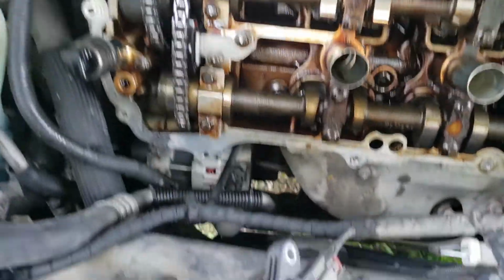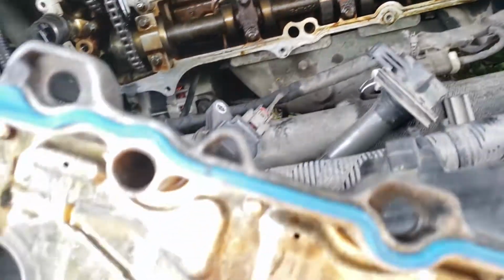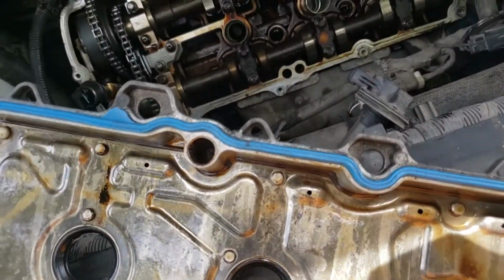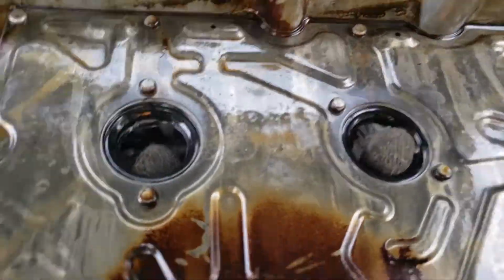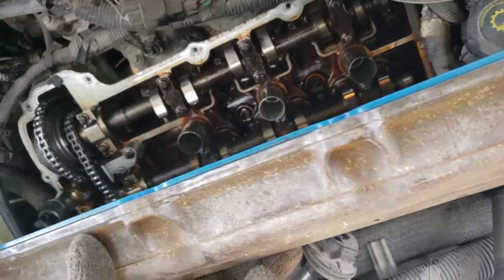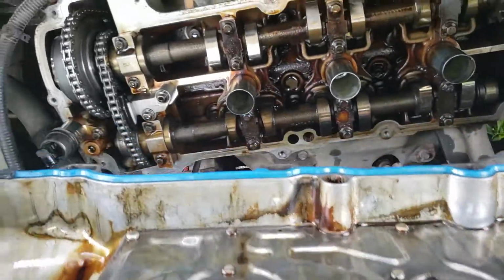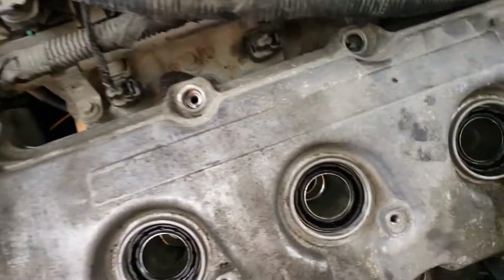A little bit of gasket sealant on the two seams between the timing chain cover and the head, so that will keep it tight. And then, just since I'm doing this one-handed, I'm gonna have to put the camera down, but essentially you want to sit this on there lower side first, and then making sure that it's in place, and then just putting it down. So that's why we wanted to make sure that nothing is in our way. So let's get those wiring harnesses further away and we'll set it down. And just make sure that everything sits flush.